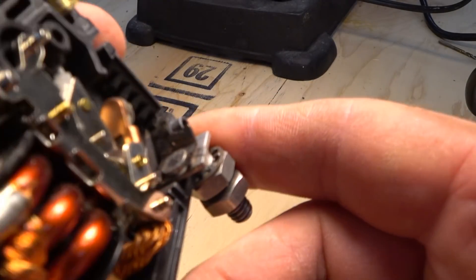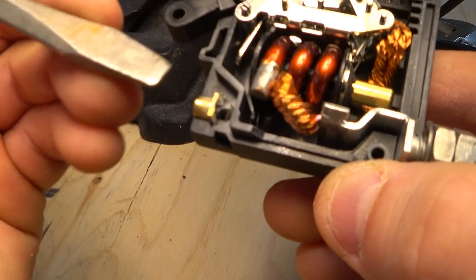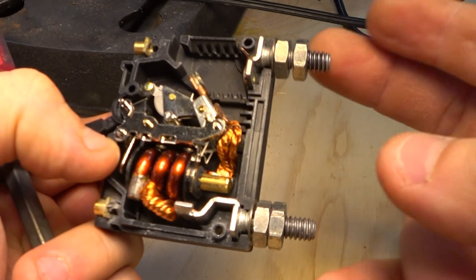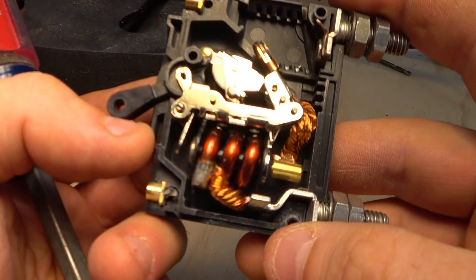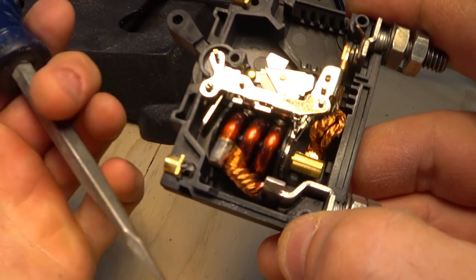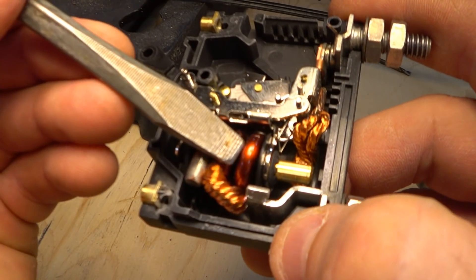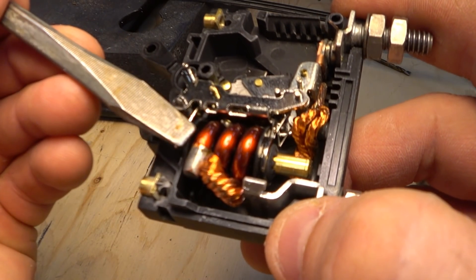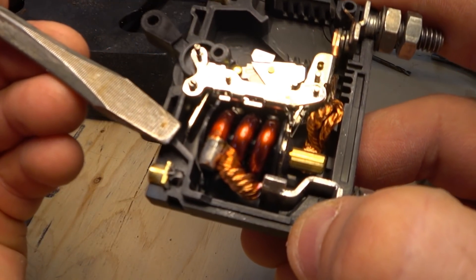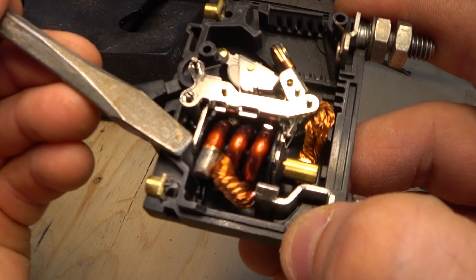Let's take a close look at this contact point. Right down here on the bottom contact you can see where it's all dark. Oh, so that's the magnet — okay. Several people in the comments mentioned there are two ways a circuit breaker can trip: one is thermal and one is a magnetic trip. This coil looks like it's probably an electromagnet. This thick piece of wire is always going to have electricity flowing through it, but maybe it just takes a certain amount of amperage to have enough strength to pull this piece of metal down, and when it does, it trips.